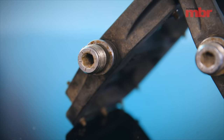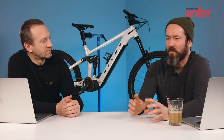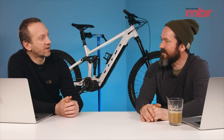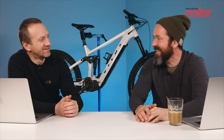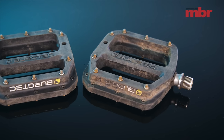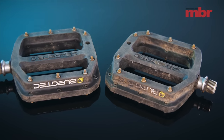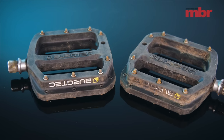Craig from Ride On had a really good little trick for them. Mine were quite old and starting to feel a little bit of play in them. He just used a positive drive screwdriver, made a hole in the resin body and filled them full of grease — essentially creating a grease port without the port. That little bit of slop disappeared and now they spin super free. For 40 pounds, if you want a really good set of pedals with good grip and durability, they're amazing.